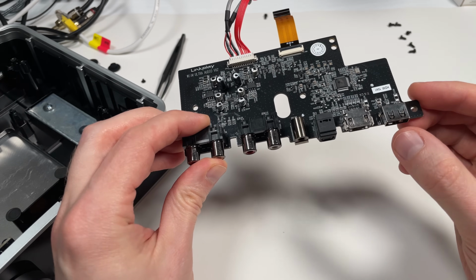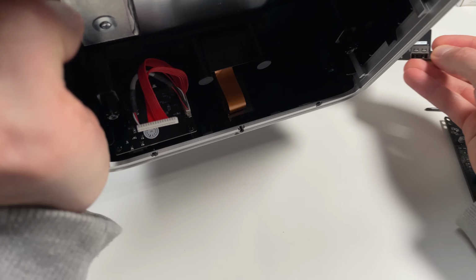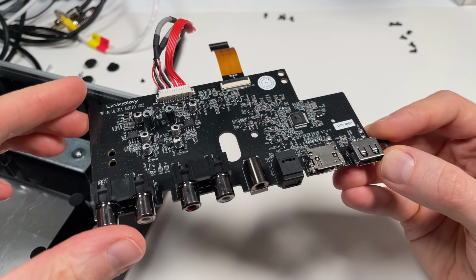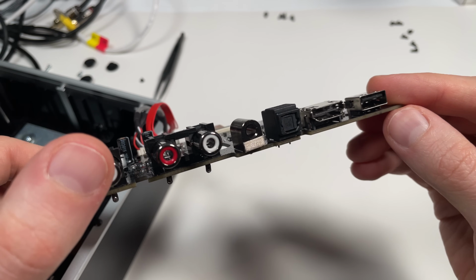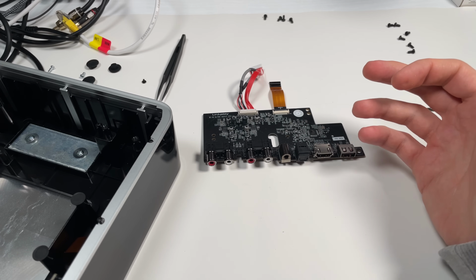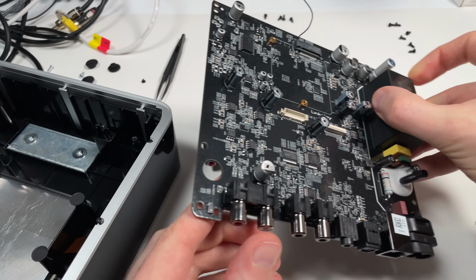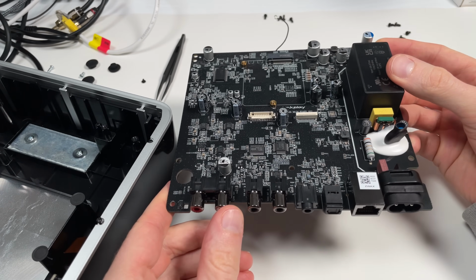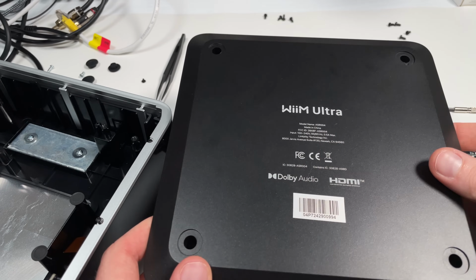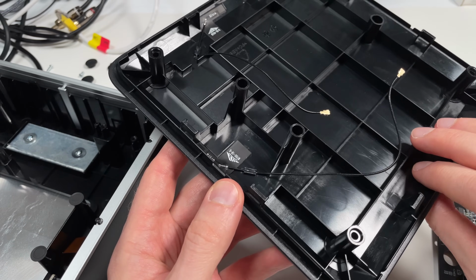Also, if you look at the other connectors like the HDMI and USB, they can technically touch the case here, but because these are just standard connectors, there are no clips around, so nothing guarantees the connection to the chassis. It may touch or it may not touch. I'm not an expert in shielding and grounding. It would be nice to hear from someone who is. Of course, the whole device is not connected to mains earth, it's a 2-prong socket. The device is also not fully covered by metal, the bottom is plastic, and you have the antennas here, probably for that reason.